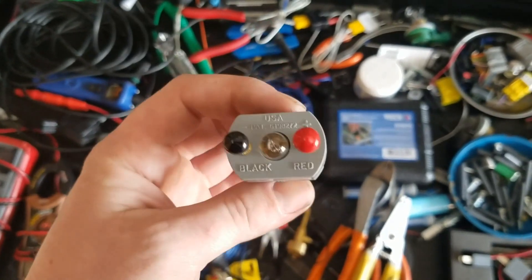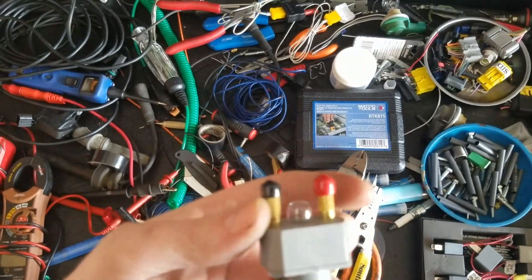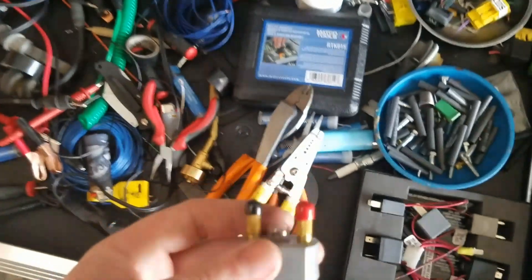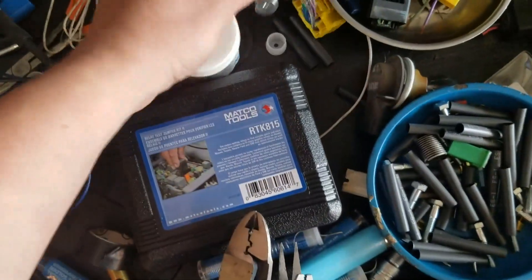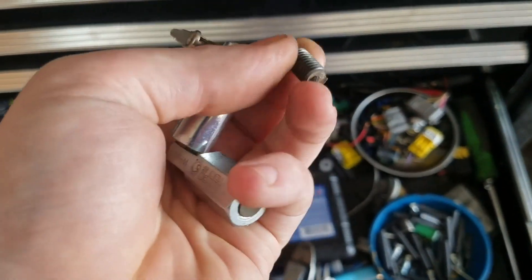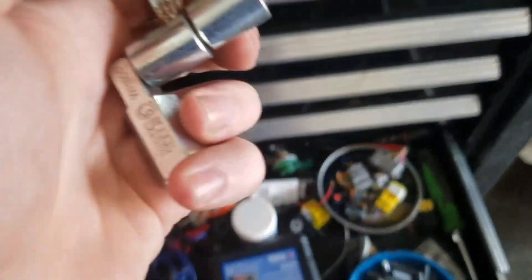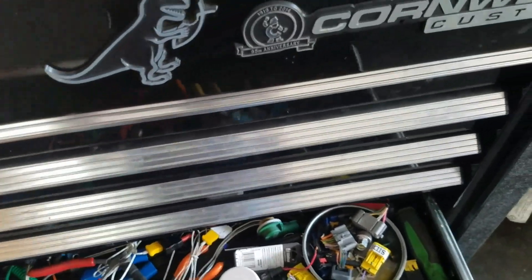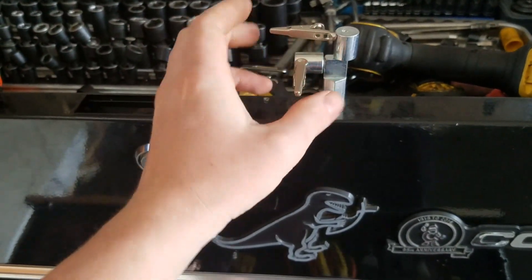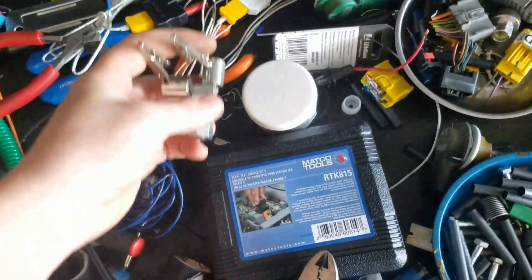A sharp knife — you're gonna need that. A torch — not really necessary for automotive stuff but works well if you're doing a lot of heat shrinking. This little guy here is pretty cool: it goes in a cigarette lighter and you can test for power with the light, or clamp off of it to supply power for some unit, module, or whatever you're testing. These little mag-base connector holder things — they've got little magnets so you can hold wires while you're soldering.